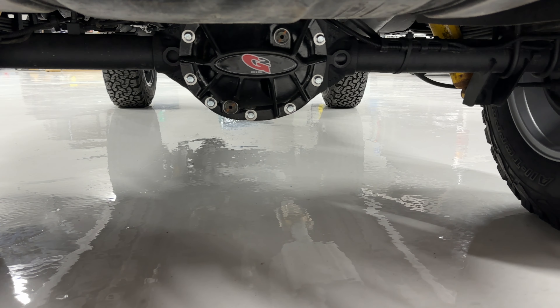There are your coil-over spacers — fully adjustable. For example, if you want to bring this Jeep up a little bit, you just wrench those to spin them up. On the rear with the add-a-leaf, it's got a full leaf spring setup plus an adjustable shackle — you can change the mount point to raise the back end. The front is adjustable three more inches with a long series shock, so the shock will go up with it. I wouldn't recommend the full three inches — in the back you'll probably get about two inches.